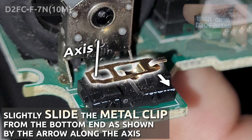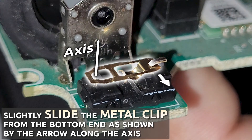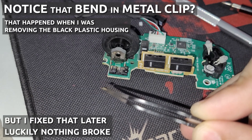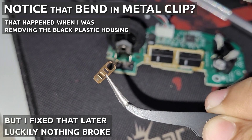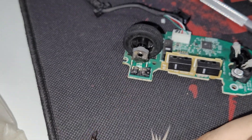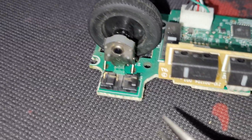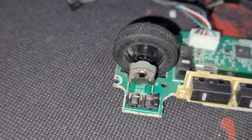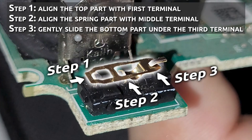This issue develops because of carbon deposits on the switch terminals, which happens naturally as you use your mouse every day. To clean it off, just use some isopropyl alcohol or glass cleaner liquid with an old toothbrush with soft bristles, and rub off all those deposits. And that's it — you're done.